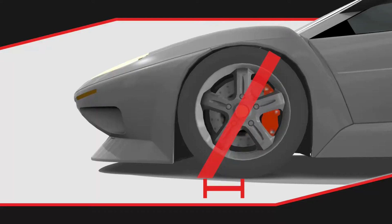If you've ever used a shopping trolley, or rolled around on an office chair, you'll know that the wheels always want to trail behind wherever you're pushing. This is because a wheel wants to follow the point it's rotating around. It's the same for a car. With positive caster, the point the wheel is pivoting around is ahead, so the wheel can follow behind, making the car more stable.